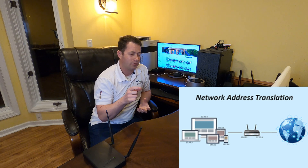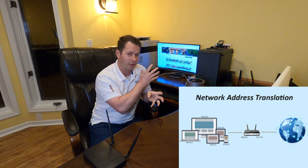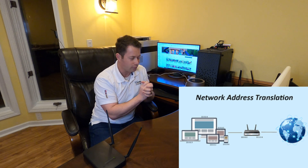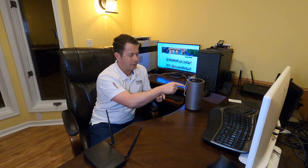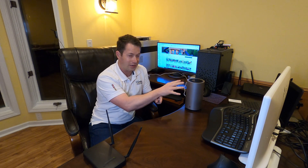All of my devices at home connected through a router with DHCP — it converts all those multiple devices, maybe 50 give or take — and it appears as though it's one device from a public-facing standpoint. So when you have this gateway and you can't turn off the DHCP server or the NAT, as soon as you add another router you're adding another layer of NAT, which by itself shouldn't cause problems until you're trying to do more advanced routing like port forwarding.